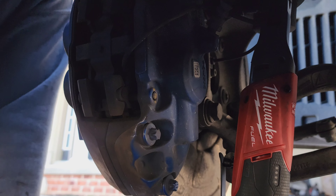I'm going to be going with Akebono brake pads — they're known not to squeak. I got all this from FCP Euro; I'll try to leave a link below. I also want to try this new tool that pushes the pistons in. If you have a four-piston caliper like that one there, you're going to need something like this — it makes it a lot easier, because pushing one piston in at a time means the other comes out.